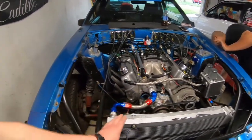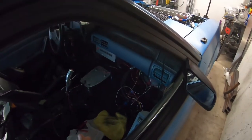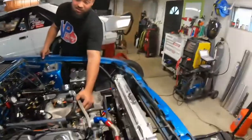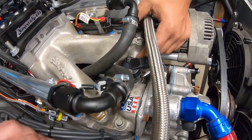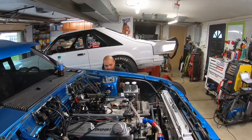MJ's car is pretty much wired. We just kind of threw it together to test everything and ran into some issues with how the HP ECU works. We were having trouble getting the coils to fire at all — it was getting RPM signal and stuff. We had to change the cam sensor because the one from the junkyard was bad — I was trying to be cheap. Yeah, at least you got the whole thing.